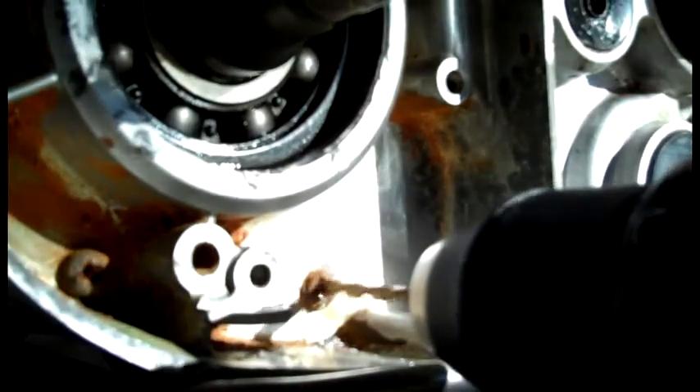So I understand that after you drill for a while it catches the screw and actually starts turning it to back it out. I actually had to reposition the engine a bit to put more pressure on it, and lo and behold, after it was only in about a half an inch into the screw — maybe even a little bit less — it did start turning the screw. And that was a very easy process compared to the easy outs.